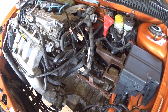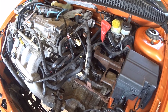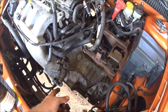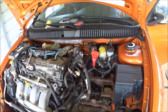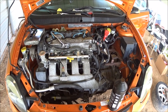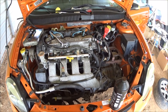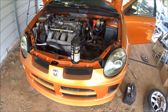What I'll do is in a day or two — I've got to put the radiator in, the battery box, and a couple other things in this car, plus the computer, which you don't put in until after the radiator. Once I get everything assembled, I'll probably come back in a day or two and do the bleed process again. I'll be pushing on the clutch getting it to start, and as long as it disengages the clutch and releases the pressure plate so it can be shifted, it's fine. But I will do the bleed process over again — actually push on the slave cylinder to see if I get any air bubbles out, just to make sure I have all the air out of the system.